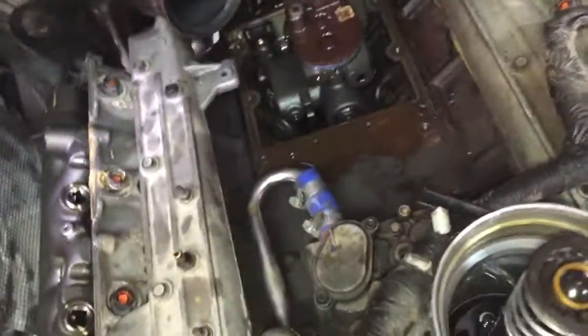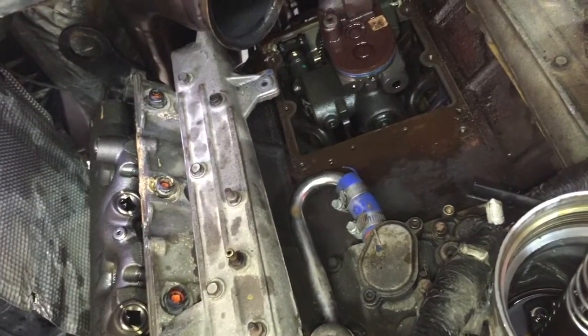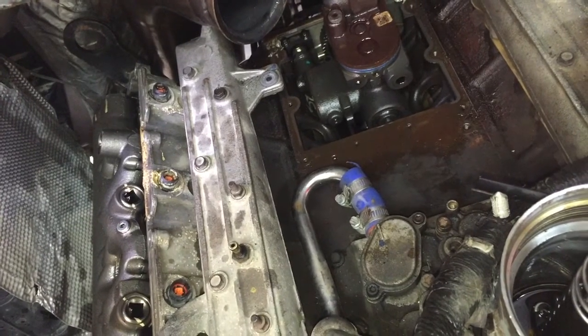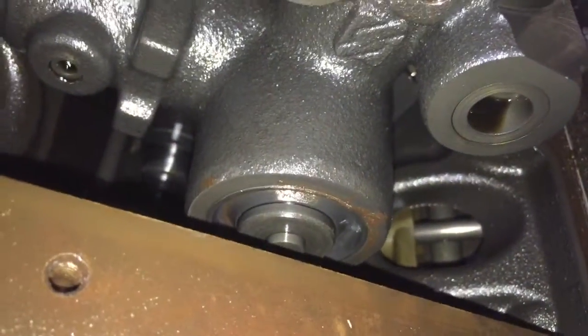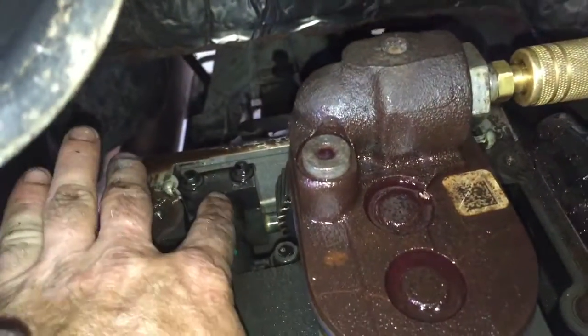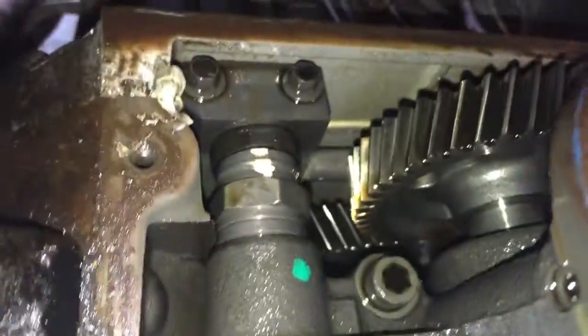But I know, Tony, you said that you had a high pressure pump. I hate to say it, but they took you. This is not a replaced high pressure pump. This is an OEM installed at the factory. Reman pumps have orange seals on the back, and all Reman pumps come with the updated STC fitting. I have not tested it yet. We're getting ready to shoot air to it, but this is the non-updated STC fitting right there.